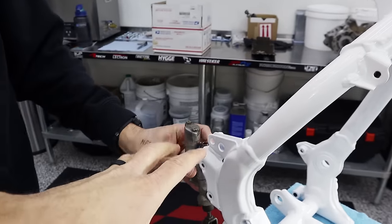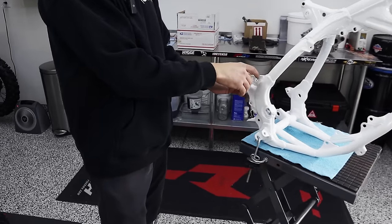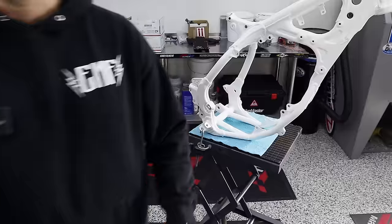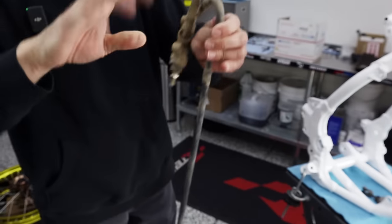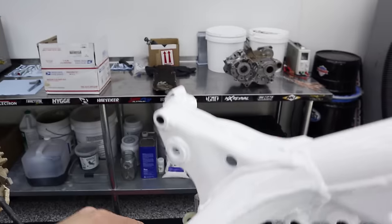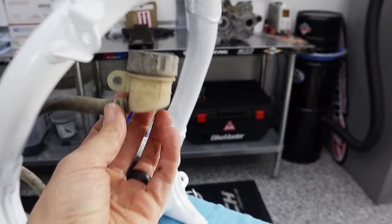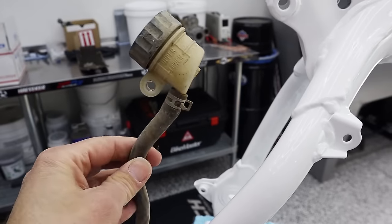So what's going on here — why does this matter? Well, we got rid of the remote reservoir for the brake fluid containment, and then there was another brake line that would run from that to the rear caliper. Here is the old setup: you have the master cylinder — it sits like this — and there used to be a hook here, another bracket right there for the hole up top. So we've ground and removed these, ditched the remote reservoir old school. That's mod number one. We'll utilize everything else — caliper hanger — but all these pieces are going in the pile.